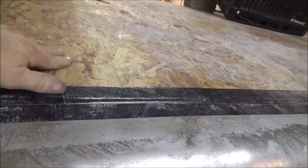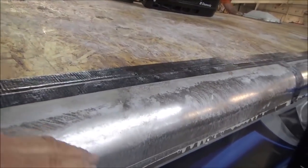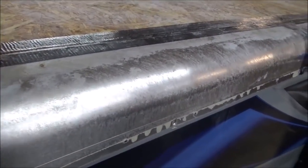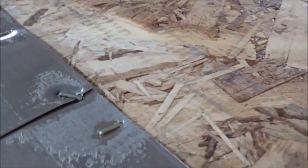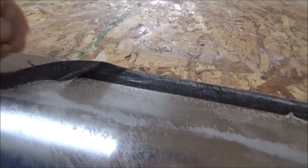When we do these we're not going to use tape. The membrane we're going to be putting down is a 60 mil commercial grade TPO - a really thick membrane, commercial grade - the kind you see on a hotel, office building, library, or restaurant. The roll comes in 10-foot widths. This coach from shoulder to shoulder is probably about eight and a half to nine feet. The rest we make little strips out of - we put the strips right here. You'll see it on this if you keep watching. We'll put a strip right down here to protect this so you don't have this sharpness compromising the main roof.